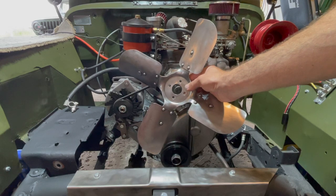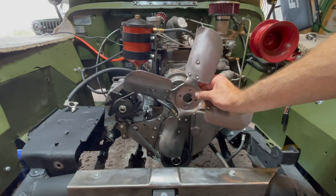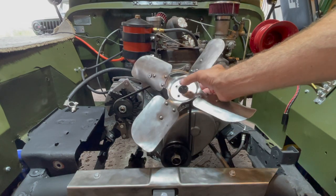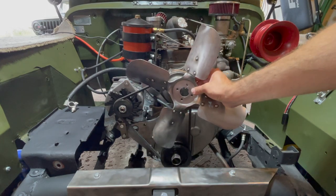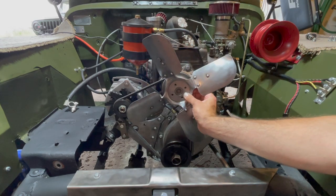Your fan will be installed directly to your water pump. All you have to do is align your holes with your fan and your water pump, and your fan is orientated this direction. As you can see there is this indent — this indent will be facing outwards or towards you — and all you have to do is align your holes up and push your bolts through.